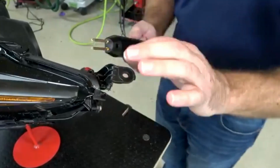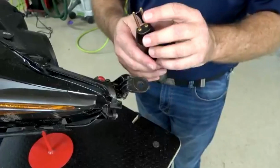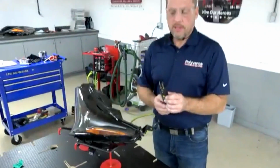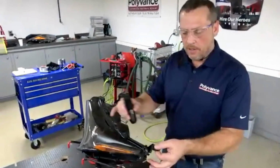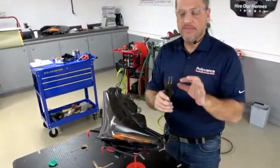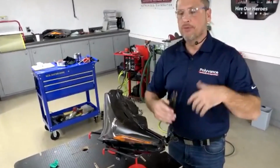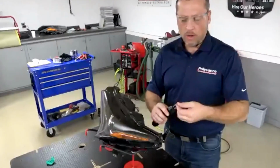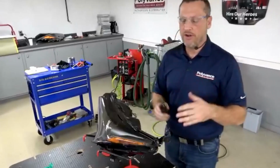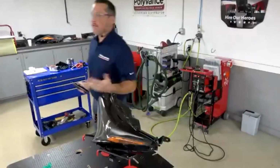That's exactly right, Kurt. If you were going to do some body work on a tab, these do get in the way sometimes if you leave them in. And these staples, if this tab was under pressure enough to break, these little staples aren't going to save the day and prevent that tab from breaking again. That weld is much stronger than this actual staple is. So it's really not necessary to leave the staples in. They're not helping that much as far as strength.